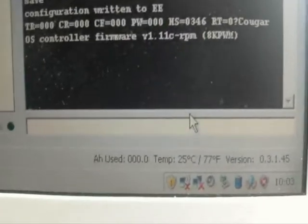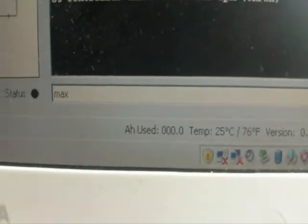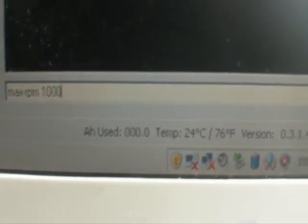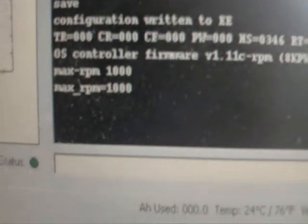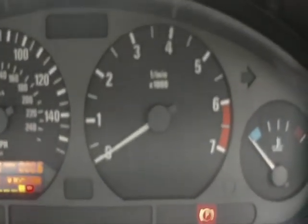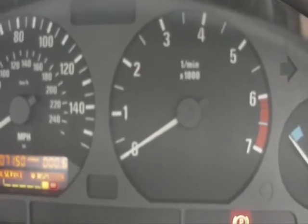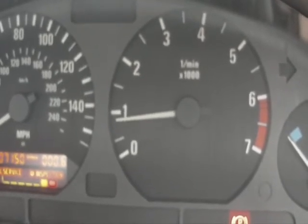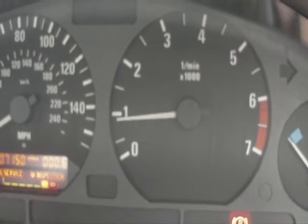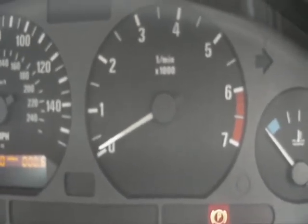Max, maximum minus RPM. In this case, I'm going to set it at 1000 RPM. Press enter. It gives me an acknowledgement. If I now get the computer out of the way and get a look at that tachometer, and give her some juice — there we go. You can hear the motor kind of hunting there, at about the 1000 RPM mark. That function is now working in the software.